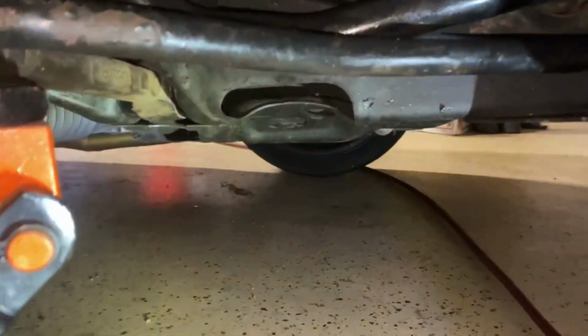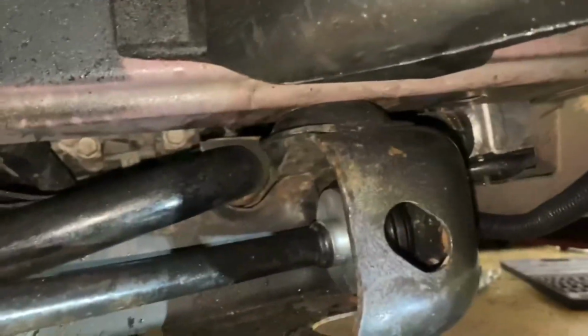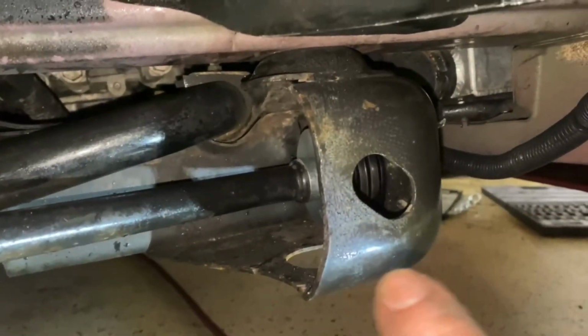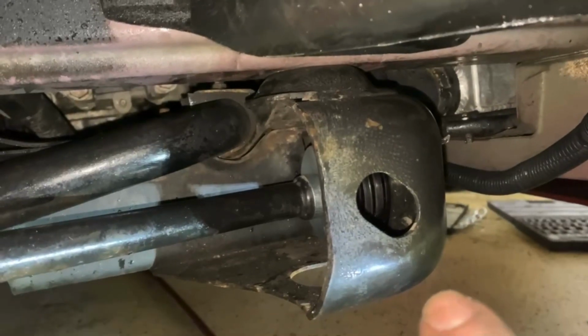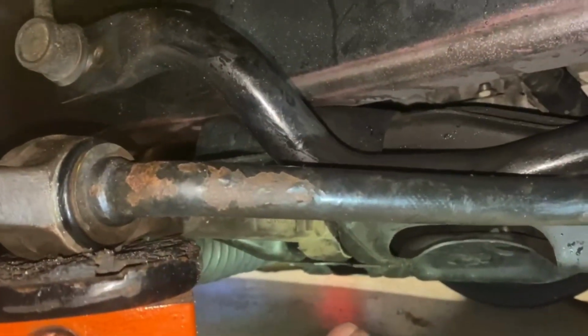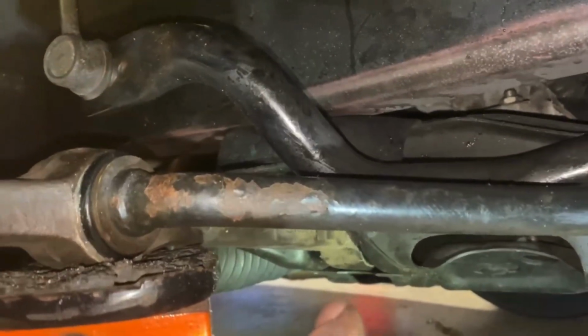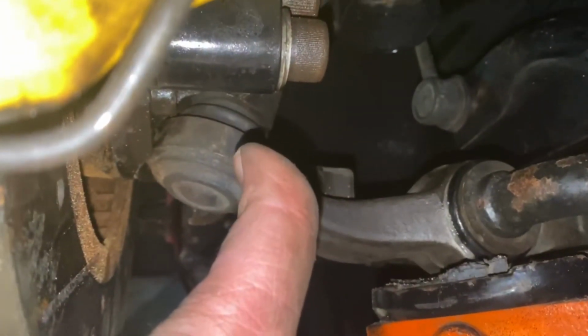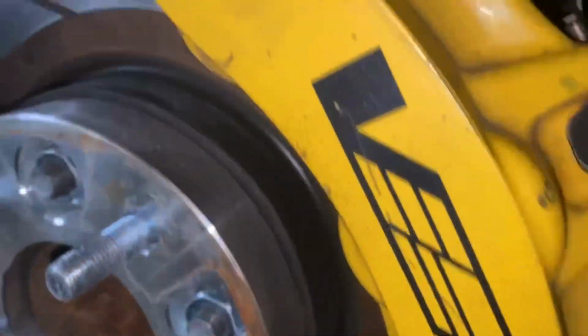I will say, however, I misspoke. The front of this, the radius rod bushing, is torqued to 106 foot-pounds. The inner lower control arm is 76, I believe, and the radius rod is 74. Again, I will leave everything in the link in the description, and this is 44. The lower control arm ball joint is 44 foot-pounds. I will leave everything in the description, a link in the description.